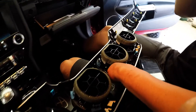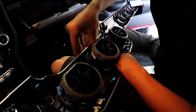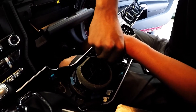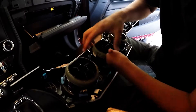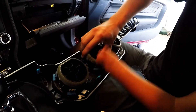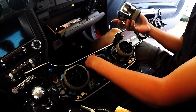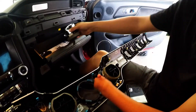Now, to get rid of the AC vent where your N-gauge is going to go, you're going to push this one back, push these inward or also back. These inward as well — and yep, almost fell in. There you go, that's your AC vent. Not really much to it, just a little AC vent. Not too much in there. Put this aside.